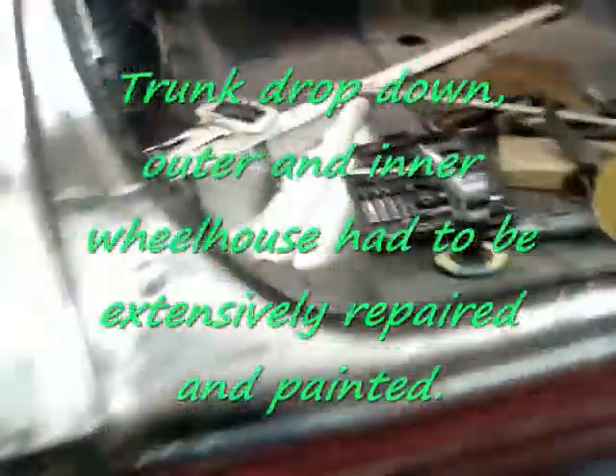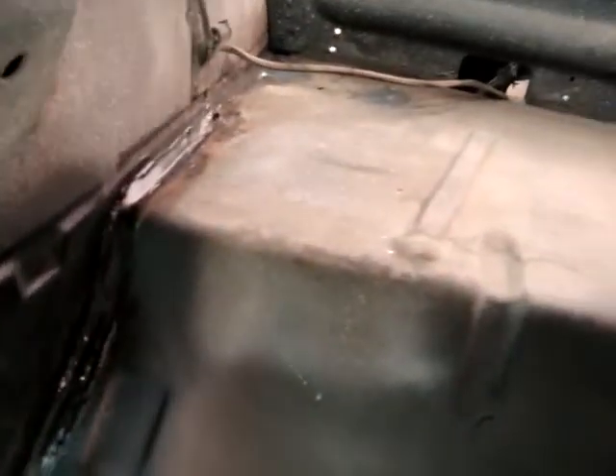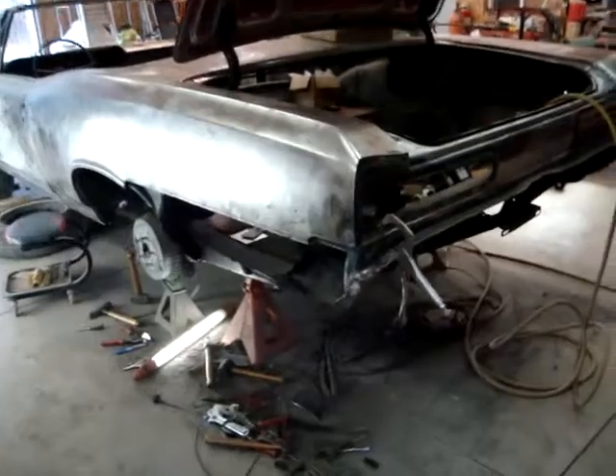On the inside, seam sealed all this down here on the bottom, all the way up. Bring it back to get this welded on. Working on the bottom of this quarter panel patch now — painted inside of here. Some people don't do that. You can tell my holes drilled where I'll spot weld the bottom on at the end. Top is a fillet weld on this flange seam here. Bring it back, get this seam place ready to hold it on. It's Saturday, four o'clock, I'm done here today.